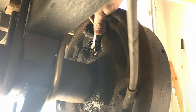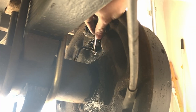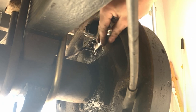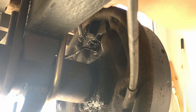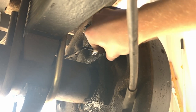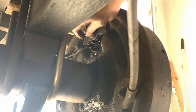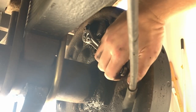With a small wrench, try to remove the brake line next. Ensure that it doesn't twist too much and brace it if necessary. Be warned that these old brake lines, especially if original, are prone to breaking as you will see here. If it does break, not to worry — your local auto parts stores will have brake lines you can install — just move it out of the way and continue. Ensure that you place a rag over it if it is dripping fluid.